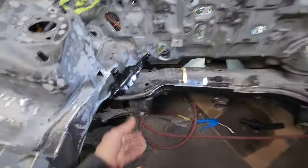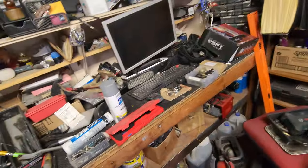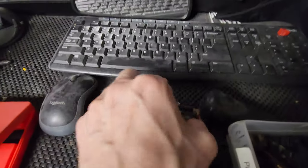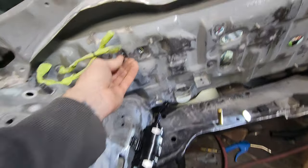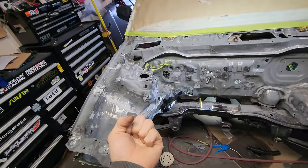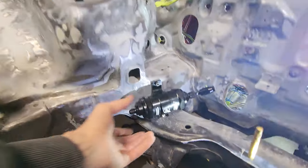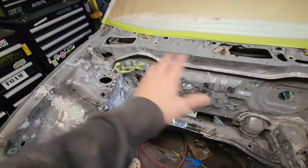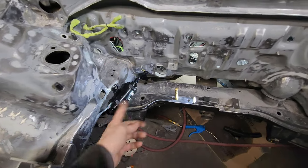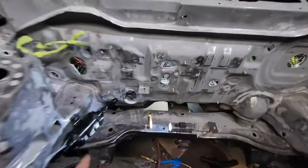As I was getting ready and filling up bolt holes I thought now would be a good time to drag out all the nut rivets, get all my hardware together, see what fits where, and drill out the holes to the appropriate size so my nutserts can get in there. Then I can squeeze them and they'll be there forever. The last thing I had to figure out was where the holes were for this guy down here - it's just hanging, literally sitting in there. I'll wait until after paint before I squish those permanently throughout the car.